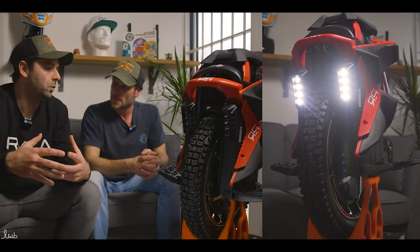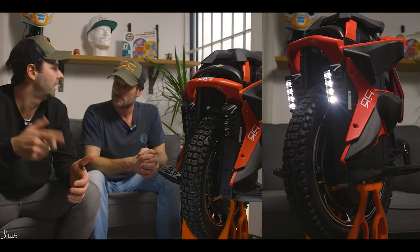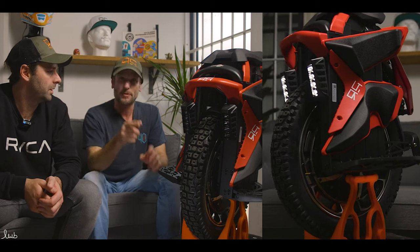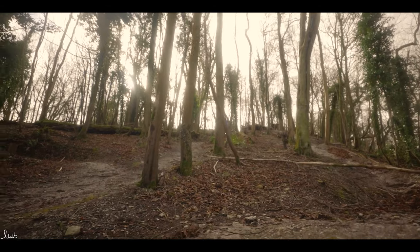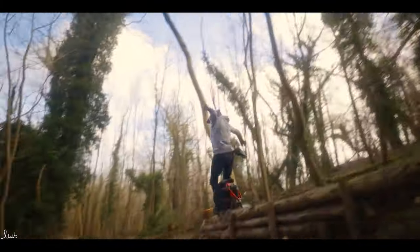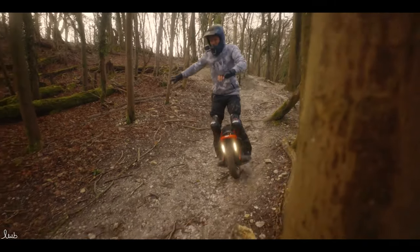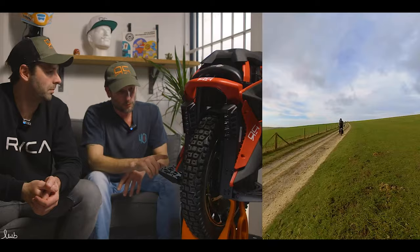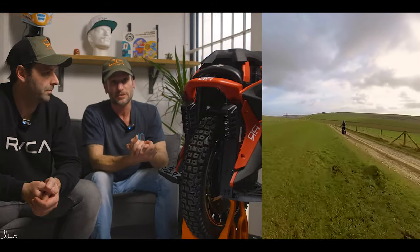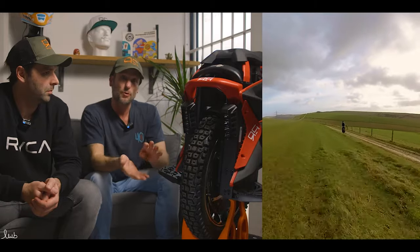With that motor, when you're jumping you need a high free-wheel speed — you need speed, you need momentum. You need the speed to cover the clearance, get the height, cover the distance. While you're going along the ground, the tires are in contact with the terrain and everything is fine. But once you come away from the ground, the gyro is working really, really hard trying to keep that dead centre of effort. As you take off, your trajectory and attitude through the air is critical — lean forward slightly and you change the attitude of the wheel.